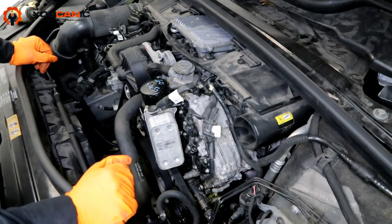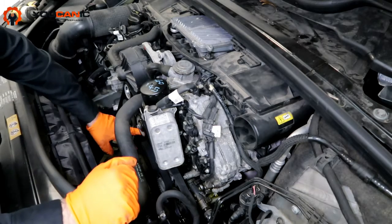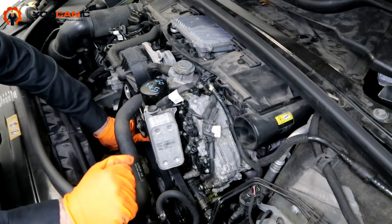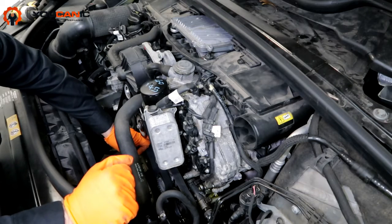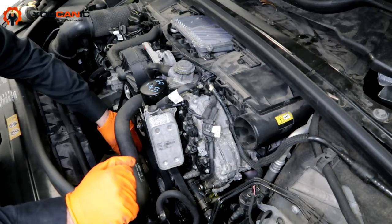What we'll need to do is turn the crankshaft to 305 degrees. On the back of the crankshaft there are numbers that go from 08 to 305. 305 is going to be straight up, and on the housing there's a line — so basically you're lining up that line with 305 on the pulley.